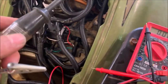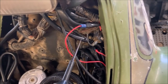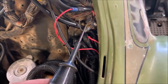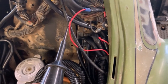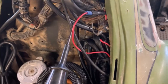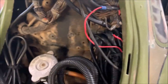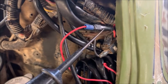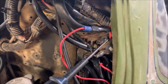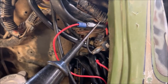I used this earlier — this is a control wire right here for my winch. I needed to find a live wire because I've got one here and then I've got this one here, and this extra control wire has to be wired in for the winch or else it won't work. That way your winch only works when the key is on. I just connected that to the negative and stuck this inside there — no voltage on the first one, stuck it in the other one and I had voltage. So then I knew that was the live one when the key is on.